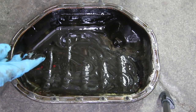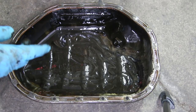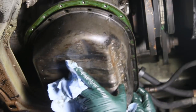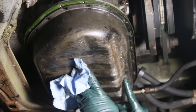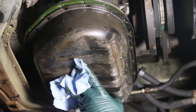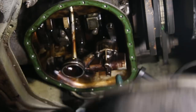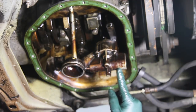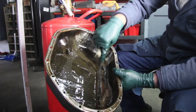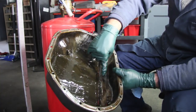It's not only just to clean the sludge out - it really came close to that oil pump housing. Take a look at how far back that damage is. We're going to lower the pan down and take a look at the pump. You can see how close that pump is, and you can actually see scoring marks. It looks like that damage came within less than a quarter of an inch of cracking and damaging that oil pump.